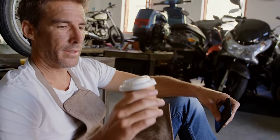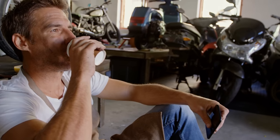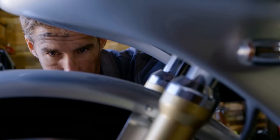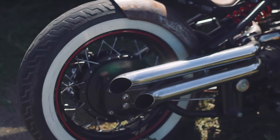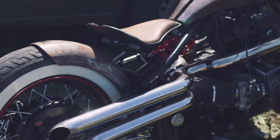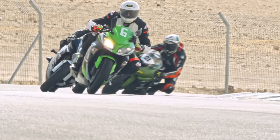When it comes to modifying beginner bikes, you can often reach the apex of diminishing returns rather quickly, and one of the big costly mistakes you can make with a beginner motorcycle is installing a full system exhaust. Sure, you might be mechanically savvy and you don't like the big bread box of palladium crammed beneath your bike, but the amount of time, money, and energy a full exhaust system will take is never going to be worth your time on a bike that's making like 48 horsepower.